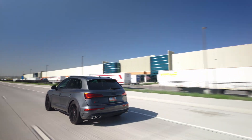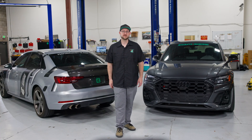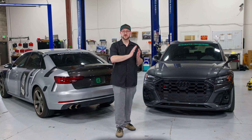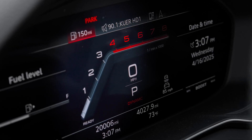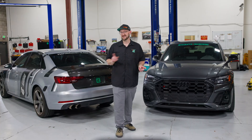We have made it easy for you to change your launch RPM settings instantly right from the driver's seat. No more flashing back and forth to different TCU tunes to test and change your launch RPM. Launch RPM can be set in real time within 100 RPM increments from 2000 all the way up to 4000 RPM using your cruise control stalk. This launch control programming is all handled on the engine tuning side, not the transmission. This feature is available for all B9 and B9.5 models with or without a transmission tune.